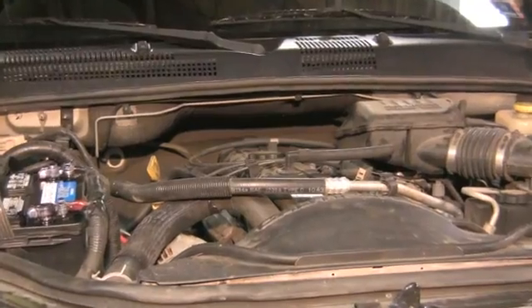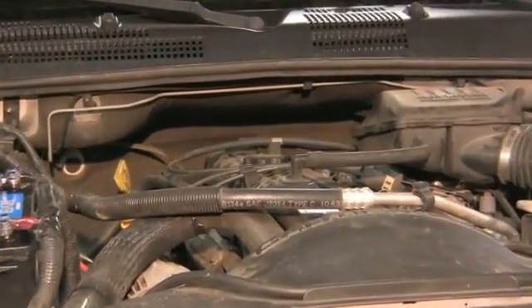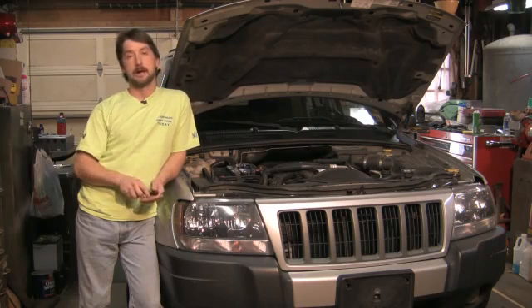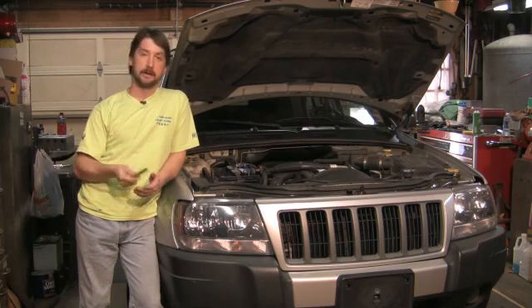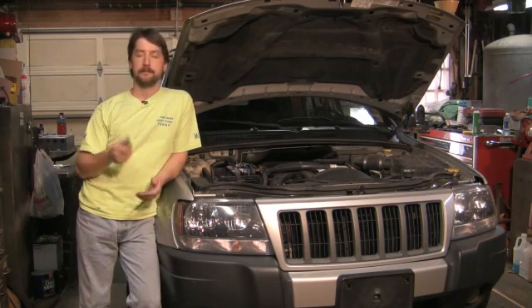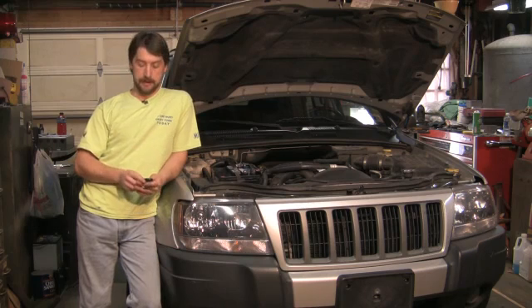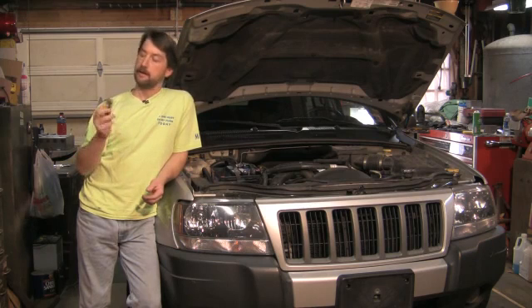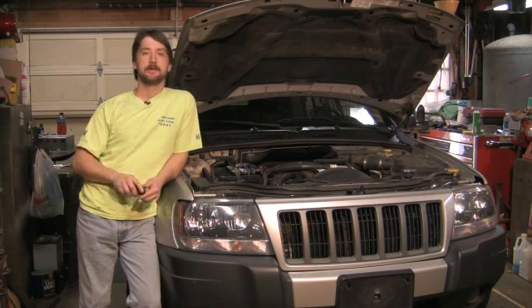When it gets that signal after hitting your two buttons, it allows it to start and run for maybe five, six, maybe ten minutes tops, and then it goes ahead and shuts down unless you put the key in it. But it's a real simple package. Any of your local automotive stores can put them in for you. It's just a little box wired into your ignition circuit and controlled by this little key fob and a computer on the inside. And that's how a remote car starter works.